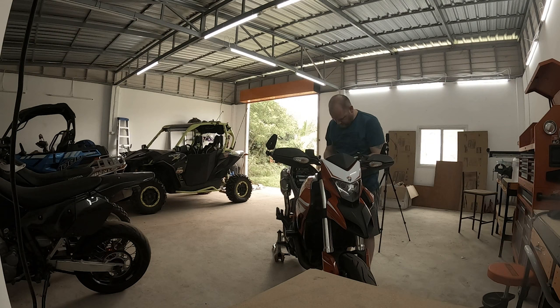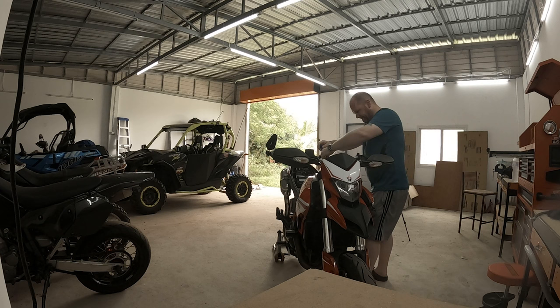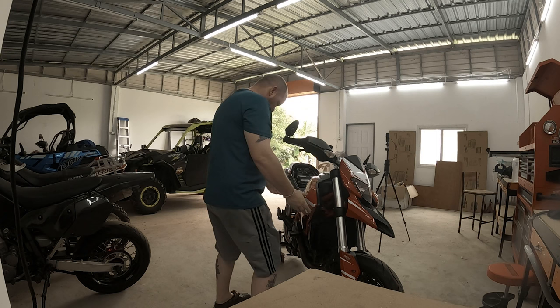Just watch so you don't lose the little plastic washer when you're taking the plastics off — they are these little shoulder bolts. Three bolts — they're four mil — no, three mil. Two fours at the side. Just slide back and off with them.